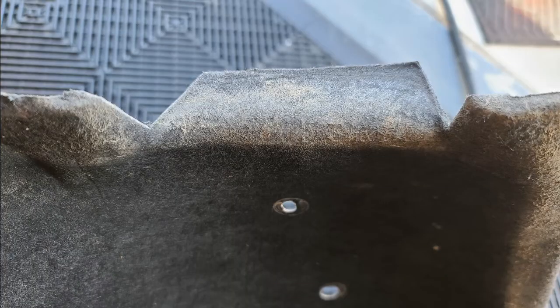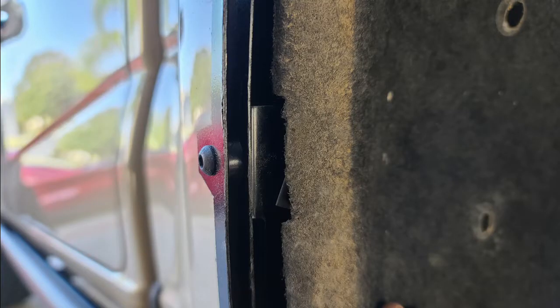Going back to how you should actually cut the material — here's a real-life shot versus the 2D diagram in the instruction manual. This is what it should look like when you cut it out. As an extra-credit step for better fitment on the plastics, I found that sandwiching the inner fender liner pushes the edge out due to the curvature between it and the plastic closeout plate. Notching around where the bracket goes to the actual cut metal provides a much flatter sandwich and prevents the plastic from protruding. Not in the instruction guide, but it does help with overall fitment.